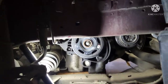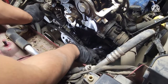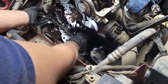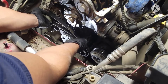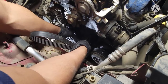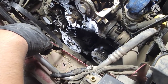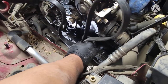I'll show you how that's done. You can wrap this around on the AC pulley here, but in this case I don't want to wrap it around because it might damage the pulley. So it's better to put it on the bolt here, or you could do it on your alternator if you want. Just to make sure I don't bugger up the pulleys. So this is how you do it — righty-tighty, lefty-loosy — we're gonna turn this to the left. Just kind of bend this belt in halfway.